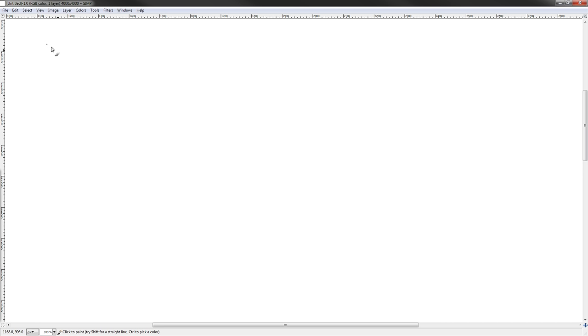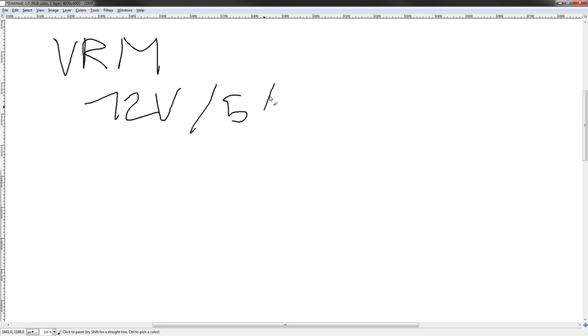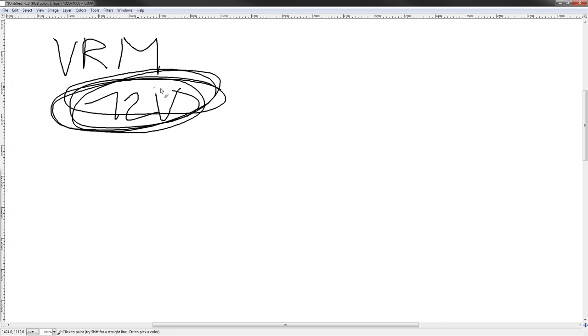So VRMs — how do they work? First of all, let's break down what VRM means. VRM stands for Voltage Regulation Module. It's an extremely generic term, doesn't really specify much. However in computers there's only really a couple of types of these, and usually when we talk about this we're referring to the voltage regulators that convert your 12 volts DC — that's what comes out of your power supply, that's your main power rail. You also get 5 and 3.3 volts, which is generally used for driving various ICs. This sometimes gets down-converted into actual usable power for RAM and some other components, but usually it's not used for anything. Generally all of your big VRMs will run off of your 12 volt rail.